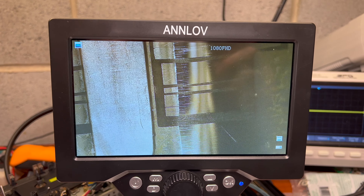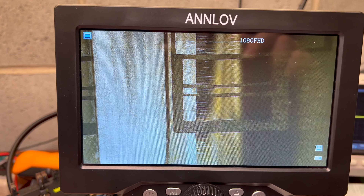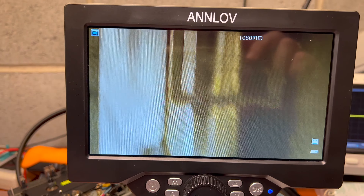We removed the large grooves and scratches. Let me check one more time that everything is good and I'll assemble it. I decided to repeat the procedure — here is what I got after a second full set of lapping. You can see it's straight, nice, and clean. I still couldn't remove all the scratches on the playback head after the second round, but it got better — there are no more grooves. It looks pretty straight and neat.